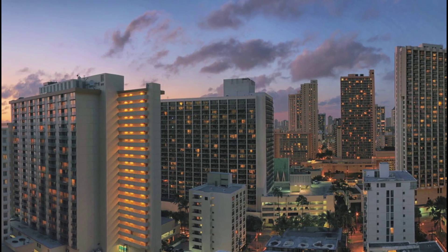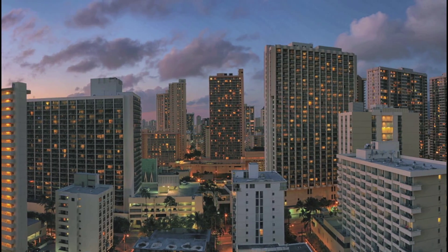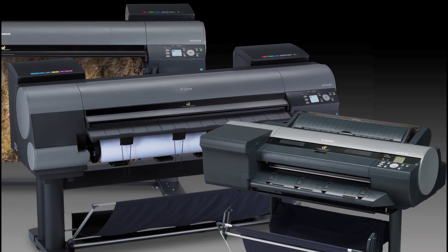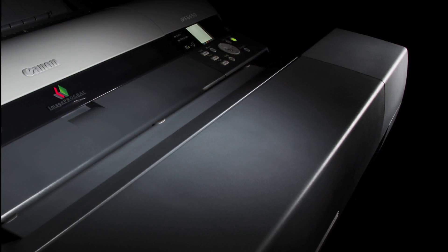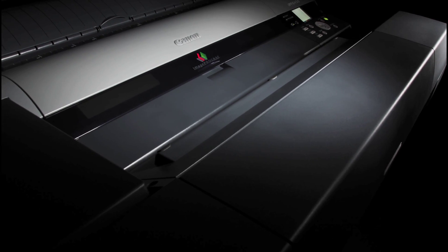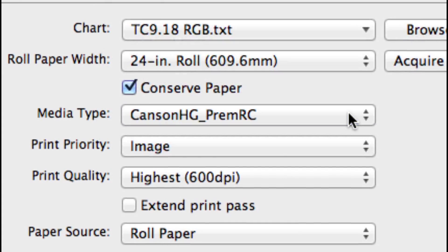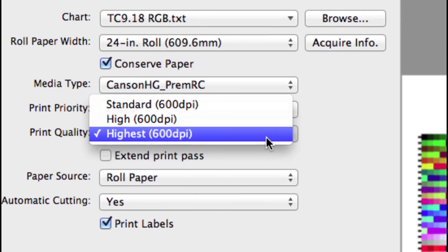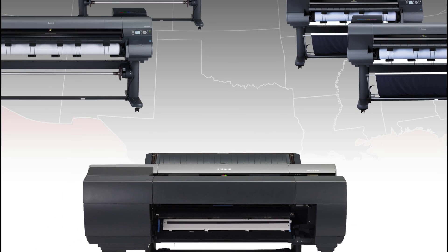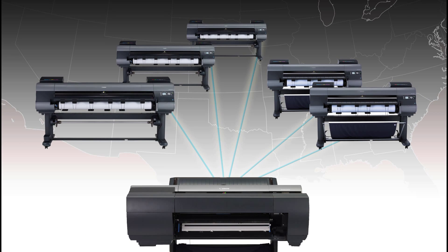The Color Calibration Management Console is designed to optimize spectral performance and density range with the Canon ImageProGraph 400 series printers. The optional spectrophotometer attachment for the 6450 will build precise spectral characterizations with the color measurement feature, and over a network or locally, update any printer on your system from a central location while keeping even a fleet of printers within a Delta E of 2.0 or less.